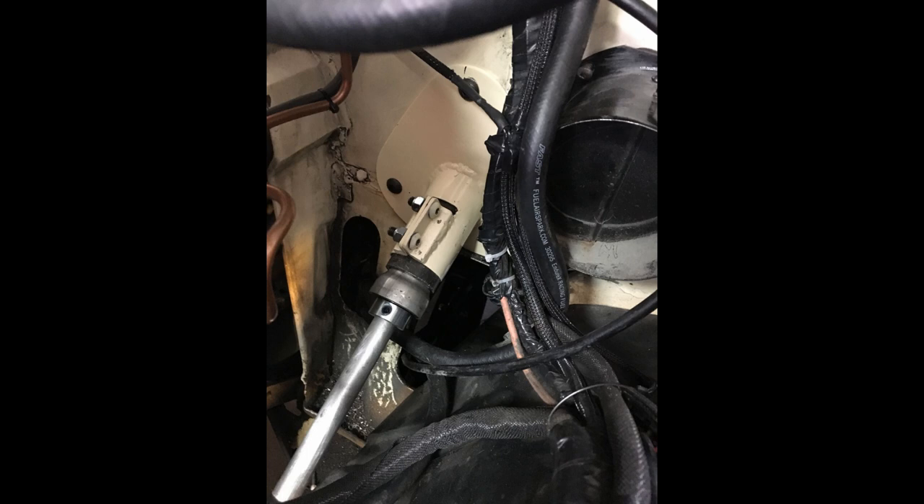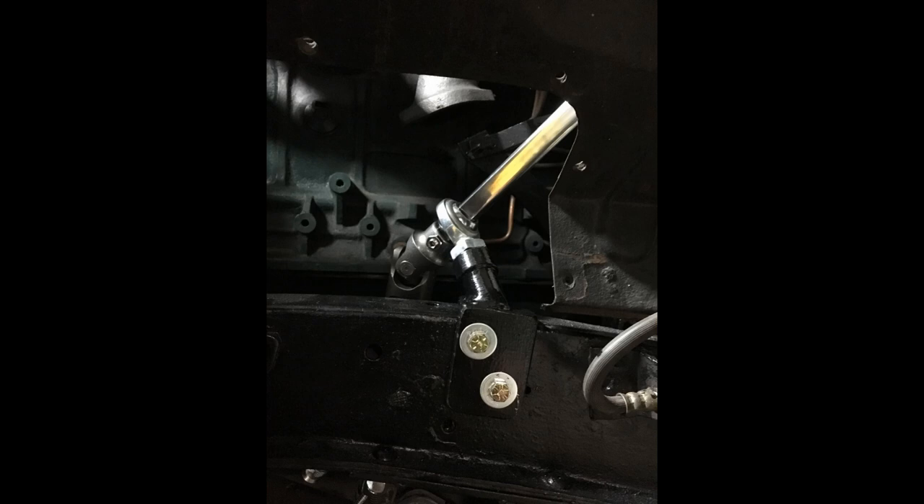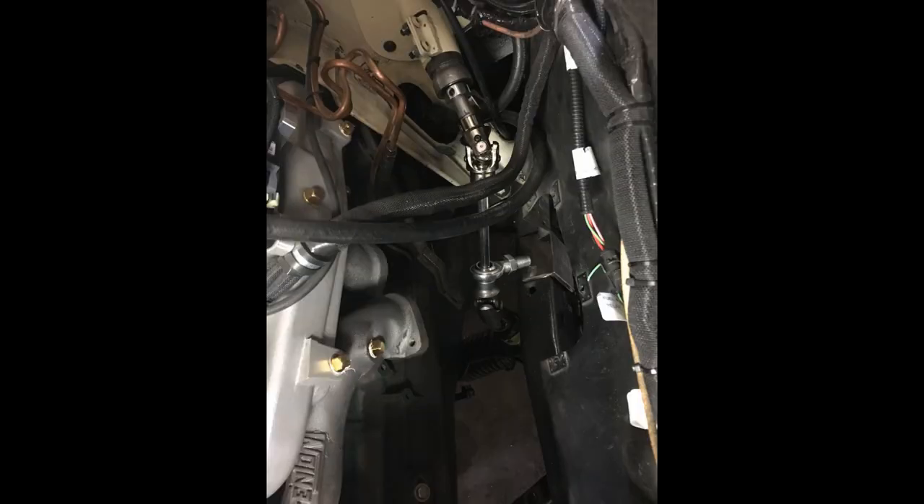This is an initial mock-up and you can see I left the steering shaft long. The reason I left it long is that I wanted a place where I could transpose some measurements for the universal joints I was putting into the steering system. I was able to repurpose one of the holes where the original steering box went. I used a piece of angle iron and welded a heim joint tube adapter cut at an angle to the top of the angle iron. After I bolted it to the frame, I tacked it and set it up exactly where I wanted my steering shaft to go through.